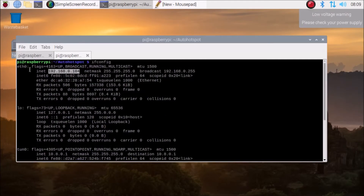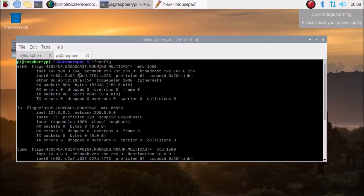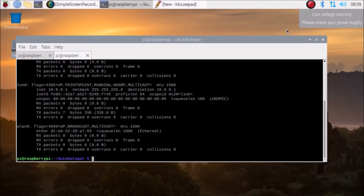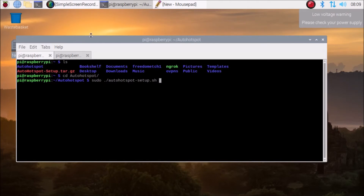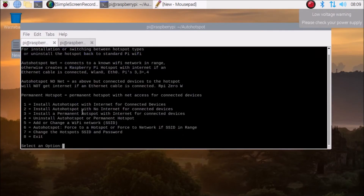You need to connect your Raspberry Pi 4 to your router using eth0 - the LAN cable - and disconnect the wlan interface from your router. If you keep wlan connected, the Wi-Fi hotspot will not work. Once that's done, we are ready to run our script.